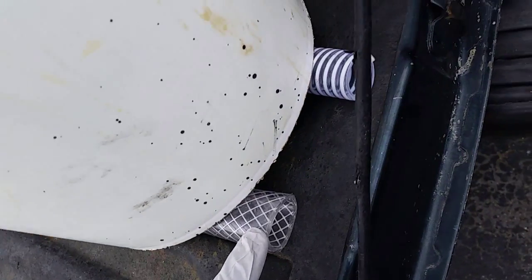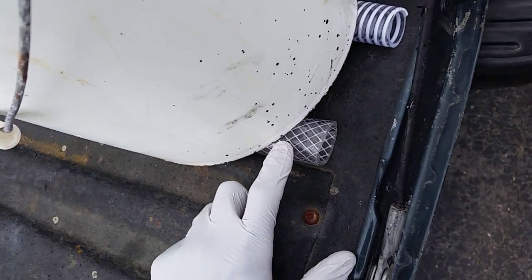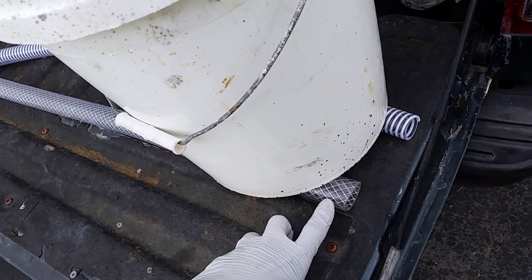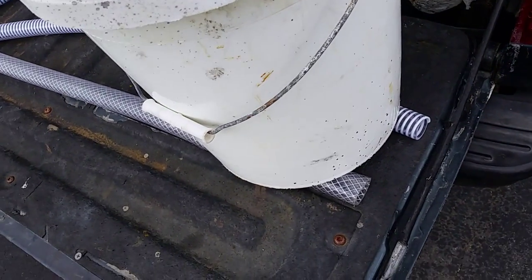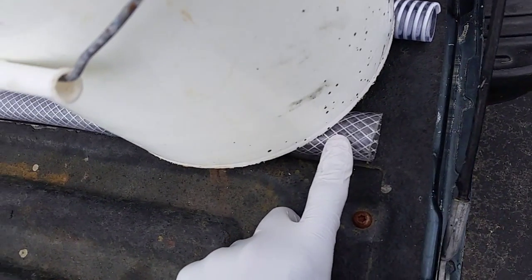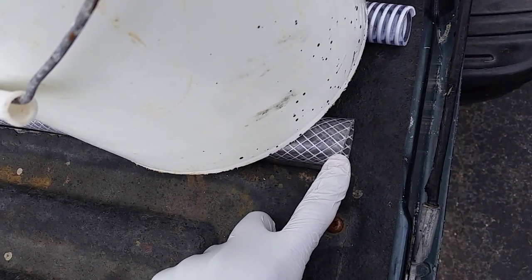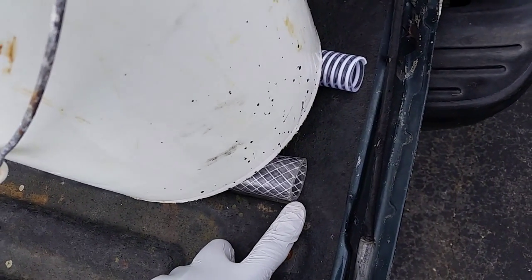The ribbed hose maintains its shape. So if you have this type of inlet line on a pickup truck or possibly a trailer, and you have things moving around and falling with weight on the hose, you can starve your pump. I know for a fact that these braided ones with the summer heat tend to deform even easier.